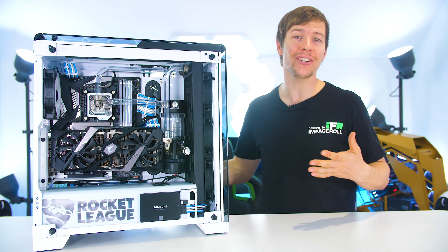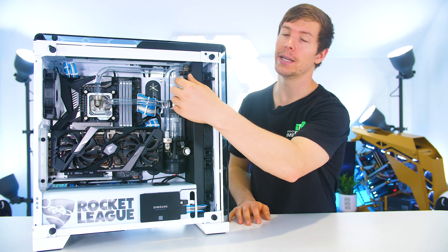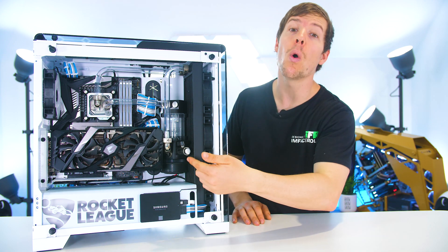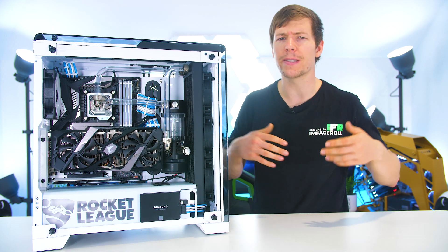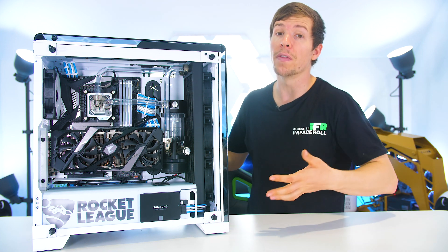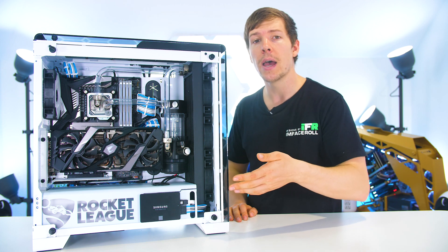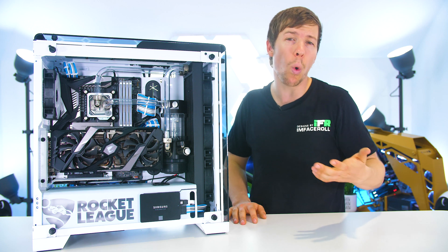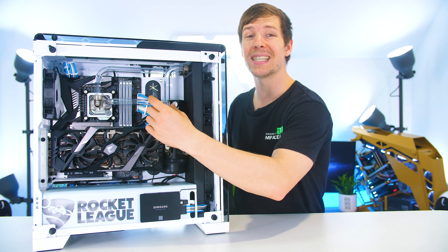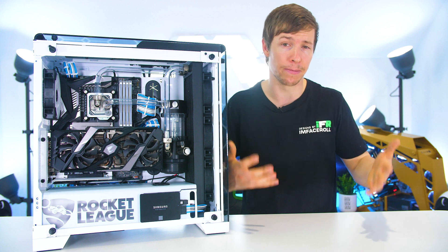There you have it — that is how you flush the system out with distilled water. If you follow the other steps to remove the remaining liquid, you can take out the tubes and tip out the small amount left after draining the reservoir. There is no blue liquid left inside after the flushes and cycles we did. So if you're just doing a coolant change and want to keep the loop together, distilled water will work perfectly. If you want to check your water blocks, you can take everything apart, physically tip out liquid from the radiator and tubes, then remove and clean the water block as mentioned.